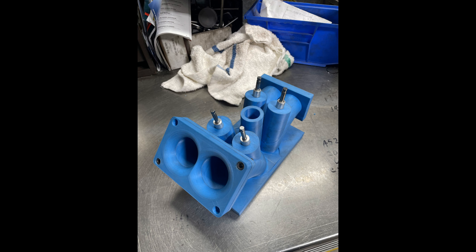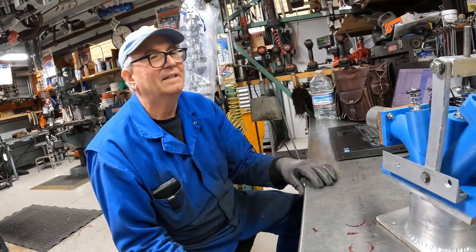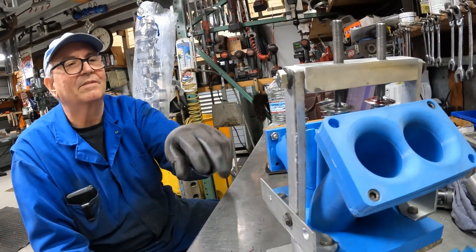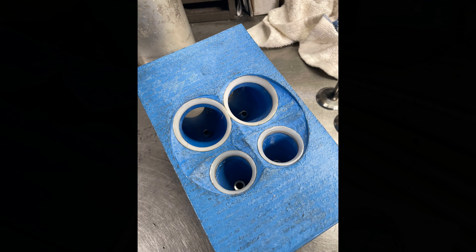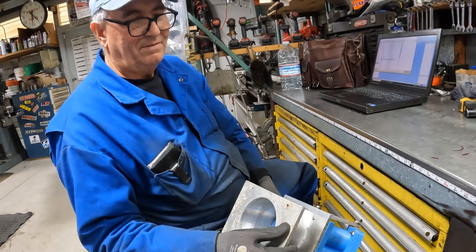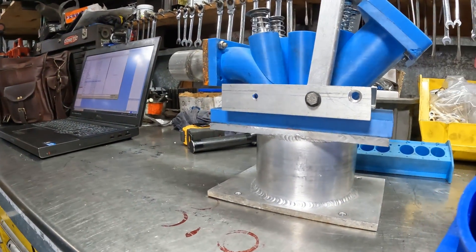Then you put guides in it and the valves in. They're just pressed aluminum guides that we made, and these are the stock length NASCAR valves — 6mm intake, 7mm exhaust. I put a plastic seat in so I could do a valve job: a 30, 60, 45. For an actual racing valve job we'd probably steepen up the angles a little bit, but this gives us a base idea of how it's going to flow.